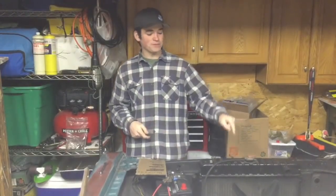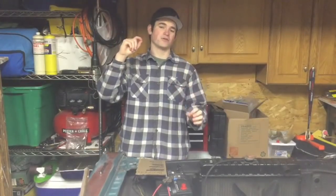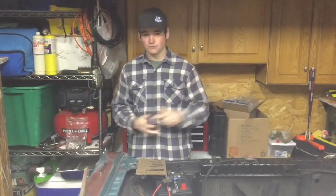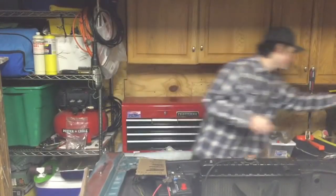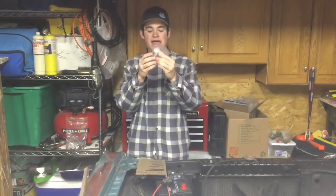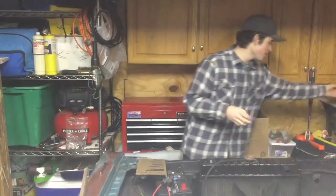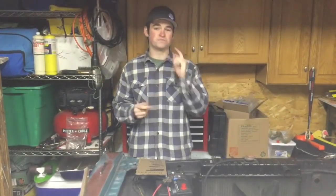I got the piece that goes from the carburetor lines down to the mechanical fuel pump, and got it tightened down onto the carburetor lines. I'm just waiting on that fuel pump to install and bolt it up there. We got all the fittings needed to go from hard line to AN line, and the other one to go between the two different AN sizes. Some of it is installed already, and we have all the hoses on but one.